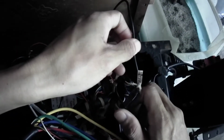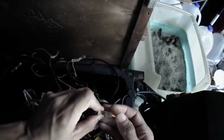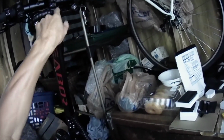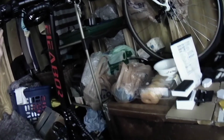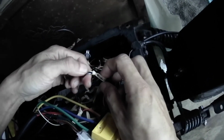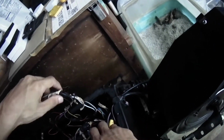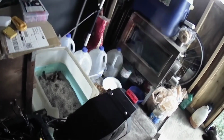When you press, this is the brake lever here. This is the left, right brake lever wire. This is connected to your left brake lever or the right brake lever or both. There's a plug connection on here where if you connect both of them, you have both left and right brake lever connected. That's what this wire is. This connects to this plug here, brake light input. This also comes from your controller A. So you need to label them because there's more than one connection. It takes more than one connection to make your brake light and tail light work.